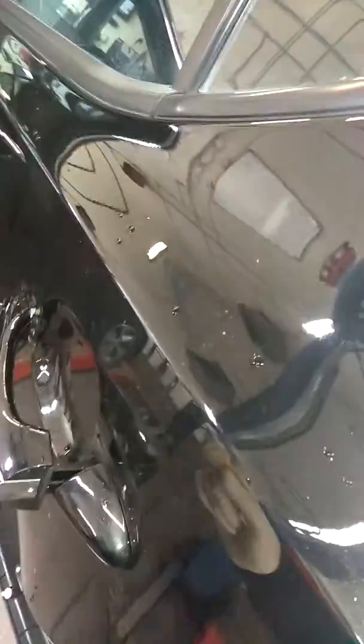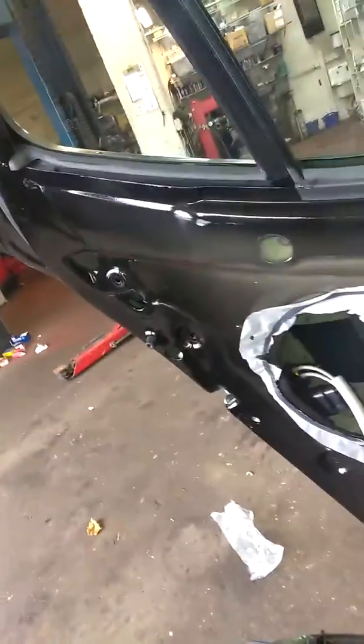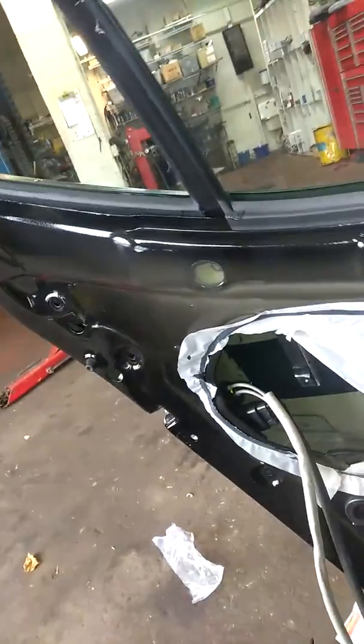So this is one piece, and this is another piece. On the inside, the problem on this car is this piece is broken and the spring's missing. When you pull that door handle, it hangs out. The only way for it to go back is to push it back. Now it could be one or both pieces causing the issue, but it definitely needs to come apart and be inspected.